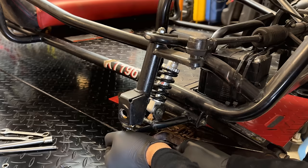Now, ideally, I'd be using a micrometer for this, but I don't have one between the 1 and 2 inch range, which is what this is. So on this journal, we are at 0.9825 inches. Let's check the other side. So they're the same size on each side.